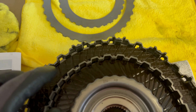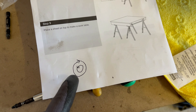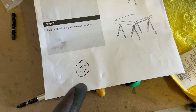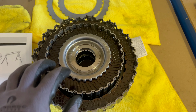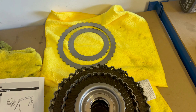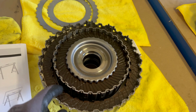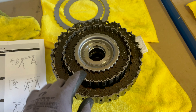This is K1 the inner clutch and K2 the outer clutch. You can see those fins or clutch material — they are pointing that way, and the outers are pointing the other way. I made a drawing — not the most accurate technical drawing but it makes sense. The inner is spinning that way and the outer is spinning the other way around, so make note of that. It goes: one clutch plate, one friction plate, alternating.